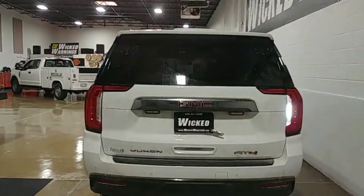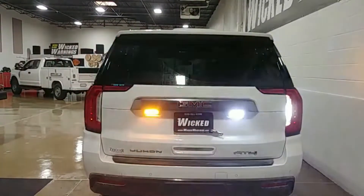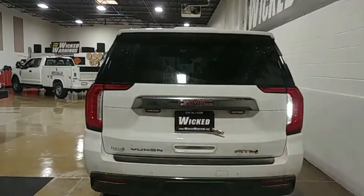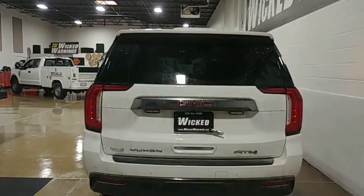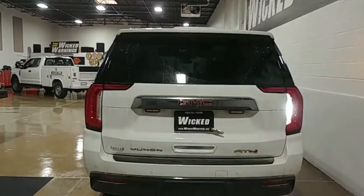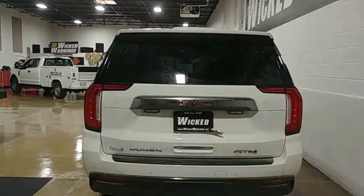On the gate itself we have our Thin-X — that's an amber-white light, LIN series, and that light has a 90-degree bracket behind it. We did need to disassemble that gate and I did a quick video on that as well. It wasn't too horrible — we take off that GMC placard, the top half comes off, then you can drill a hole, mount those lights, and run the wiring all up inside the gate just like the factory license plate light wiring. We didn't want to do any visible surface mount holes like next to the plate, police style, in the actual gate body because if you ever trade it in, you'd have holes in the lift gate.